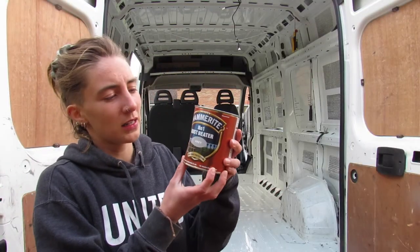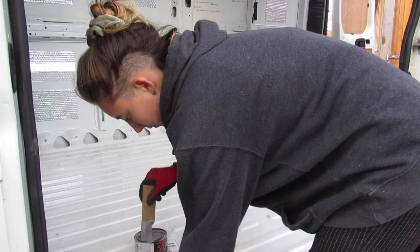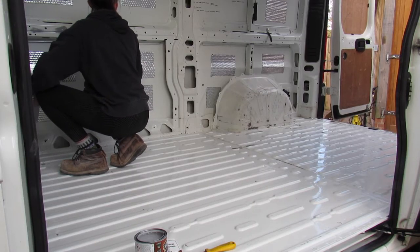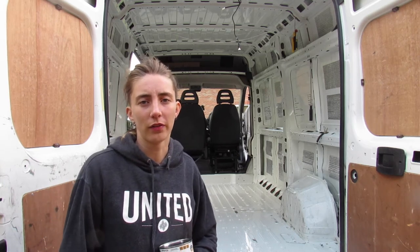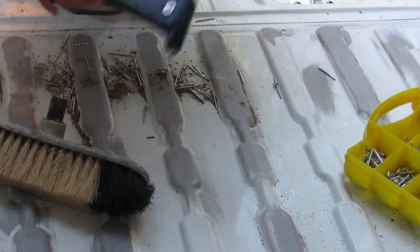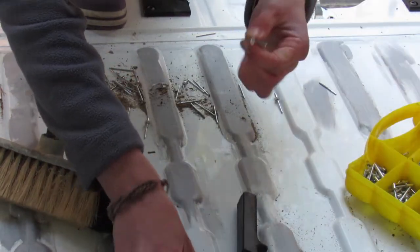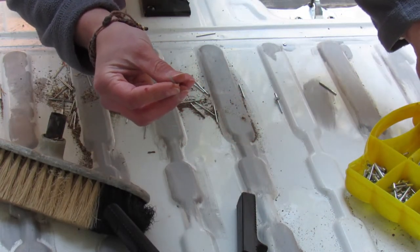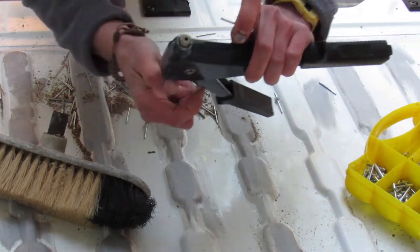This is what I've bought - it's grey, just a kind of fancy grey. I'll put a coat of this on and try to put a couple of coats on depending on how it turns out. Then in a lot of the holes I'm going to use what you call pop rivets, put those through to fill them in - they're something that won't rust - and then I'll use another layer of paint over the top to hopefully seal everything nicely. There are some holes in there which literally just go straight outside, which I didn't even realize. This is the pop rivet gun; it comes with a couple of different size nozzles because the pop rivets have a few different sized shanks depending on the size of the rivet.